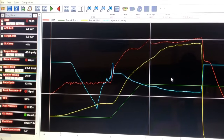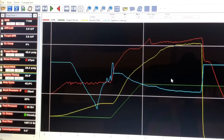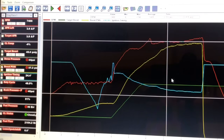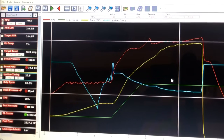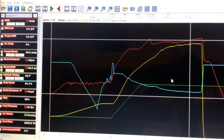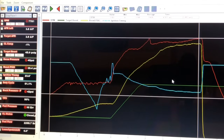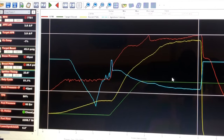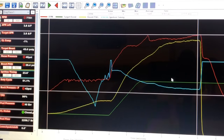Check out that boost curve — it is super lazy. The green line is what I was targeting: full boost at 1.8 seconds. Right here it had 28.4 pounds, and out in top gear it felt a little bit lazy early. It ran a decent ET for the most part, but up top it was pulling pretty good — then it started coming on up and down track made 39 pounds of boost. Dome pressure was 45, back pressure was 42, so Jose's turbo is doing work along with Little John's camshaft — just a little bit over one-to-one, you can't really ask for much better than that.